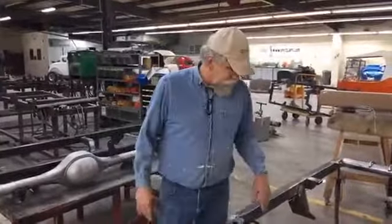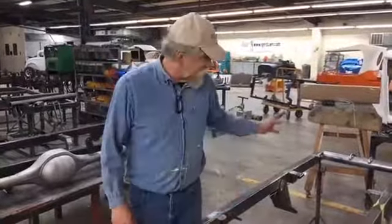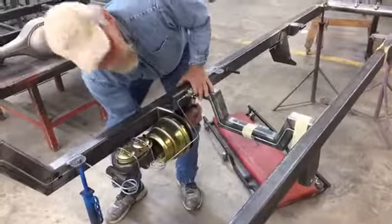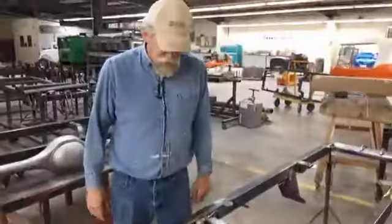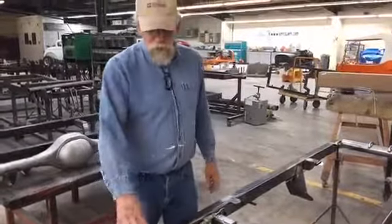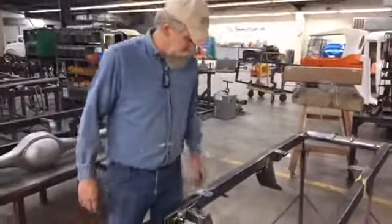If that's happening to you, you need to cut back the pressure for your front brakes, and you do that by turning the valve. Turn the valve until you get it adjusted the way you like it, and that's set, done forever. They've got proportioning valves that are built into the master cylinders, or go to them, on stock cars, so there's no adjustment at all. It's just already preset.